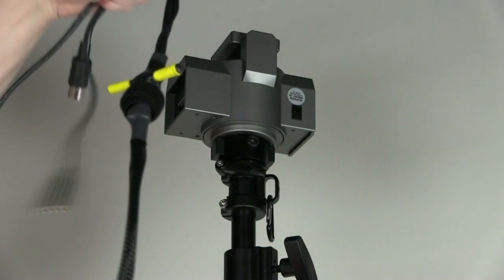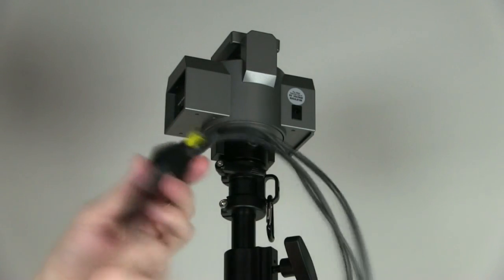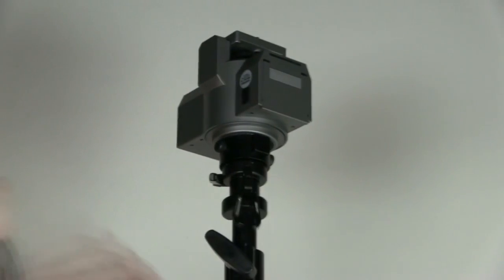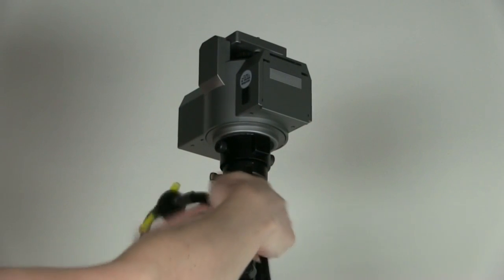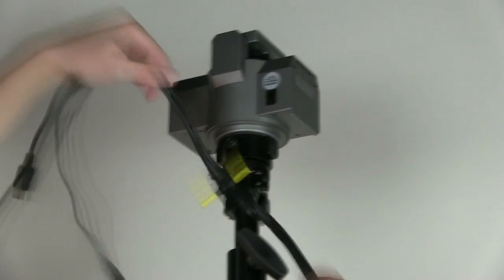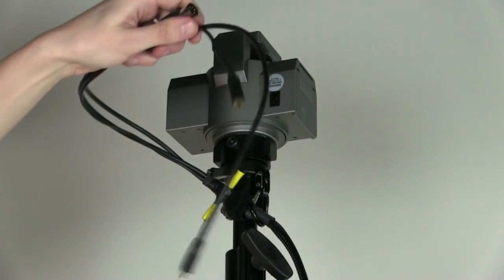Now find the cable bundle included with your unit and locate the yellow T-bar, which represents the top cabling. Find the space where the T-bar is and locate the carabiner dangling off a hook on the side at the top of the tubes. Slide the cable bundle into the carabiner so that the T-bar is above the carabiner — this helps it dangle off the side and act as a strain relief. There's additional Velcro to reinforce it even further.